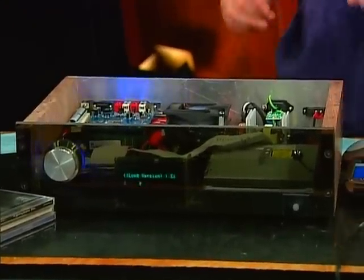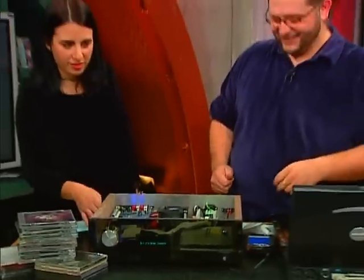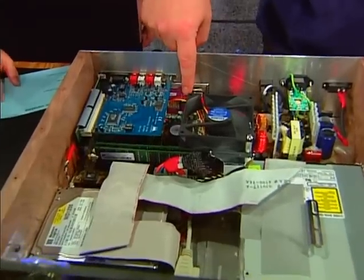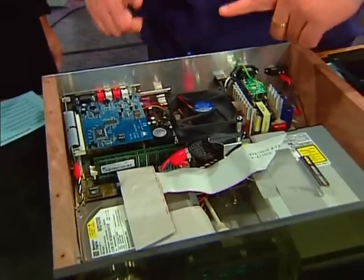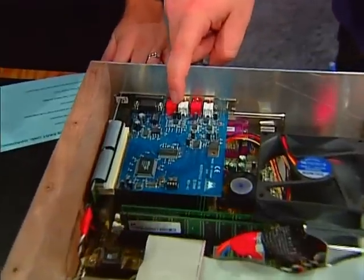I like the wood sides. It's a little retro, but I like the wood incorporated sides — very 70s. It's a nice walnut. Got to use a good wood. And essentially what's inside is a Via Epia Mini ITX motherboard, a little 800 megahertz motherboard, 170 millimeter square, nice small footprint. I've also got an M-Audio sound card — a really nice studio quality sound card.